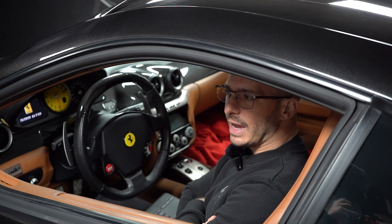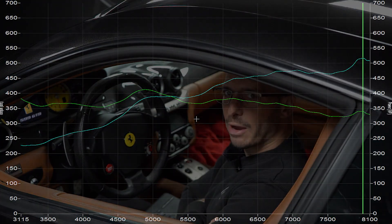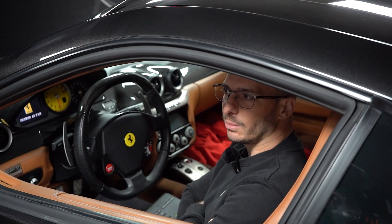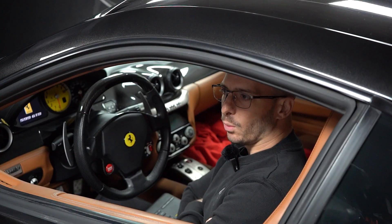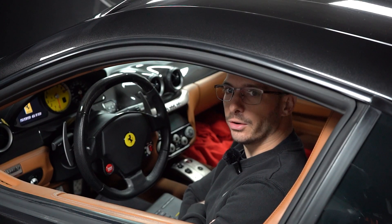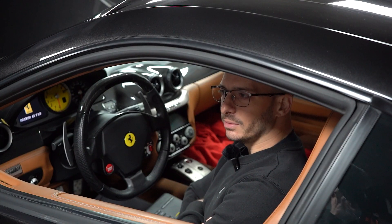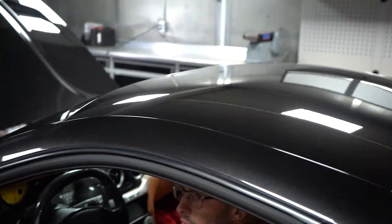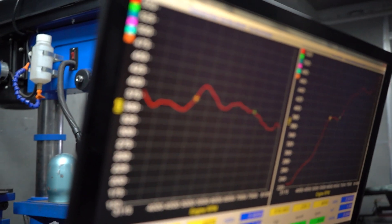We did our first pull and it made 516 horsepower, but the dyno graph is hideous — really bumpy and gross looking. We'll do another couple of pulls and see if it smooths out. It's definitely encouraging that once we put a MoTeC in here, we should be able to improve what's probably just a really overactive knock control system and bad fueling. One of the guys noted he literally thought it was a dyno issue — he's never seen a graph like that before.